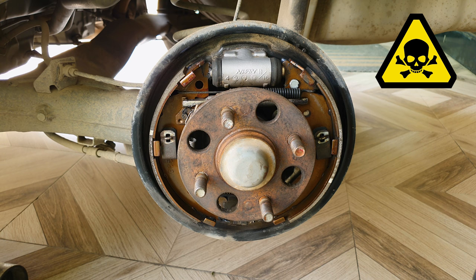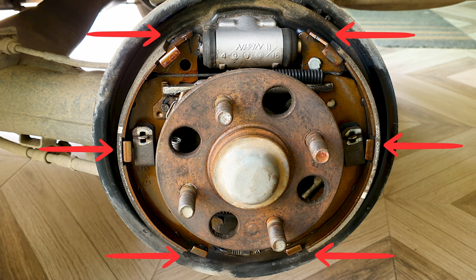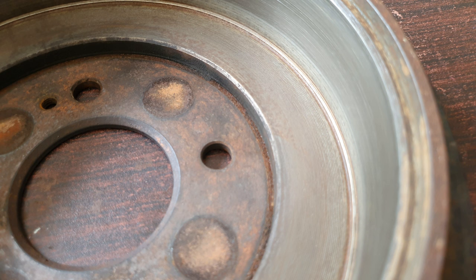Brake dust is hazardous to health, so when cleaning with brake cleaner use a mask or keep your distance. If you still have the skipping noise, check behind the brake shoes at these six points — check the condition of the backing plate. The brake shoe rubs against it and it should always be greased. If it is corroded or pitted, that can also cause the brake shoe to skip.